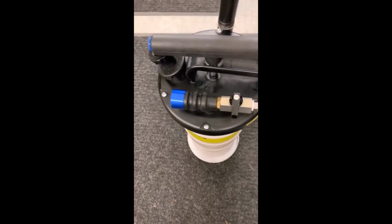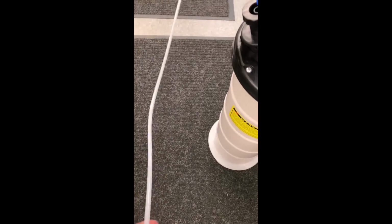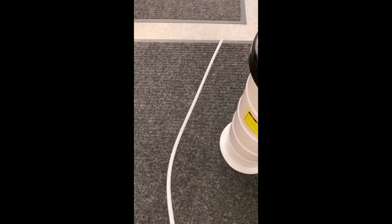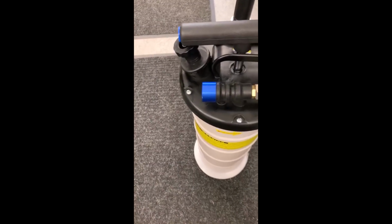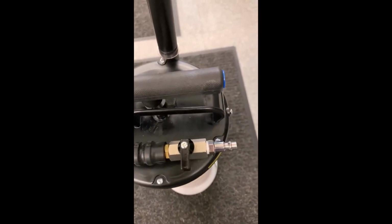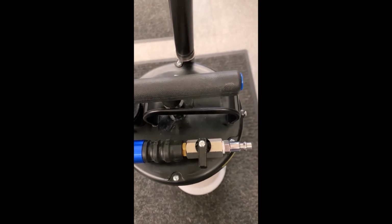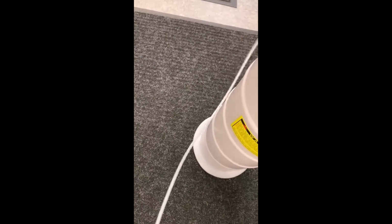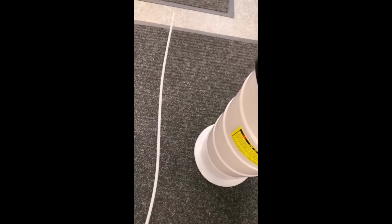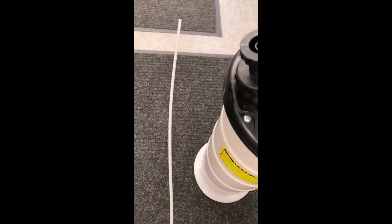The hoses that come with this type of extractor are basically firm plastic hoses. I know it's kind of hard to see here, but these things are about 4 feet long, and they don't offer much flexibility. So if you were going to try to use this, say, changing oil on a lawnmower or something, you might end up frustrating yourself. Even the smaller attachments that go into this main hose here are basically rigid, hard plastic type hoses. So this, here's the other one. This is the one I used on the dipstick for the Pilot. This is not going to be a convenient, easy system for changing oil on small engines. So I would not recommend it for that.